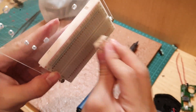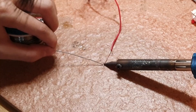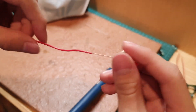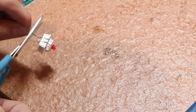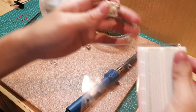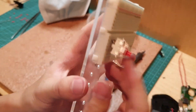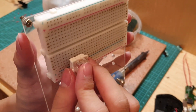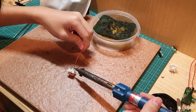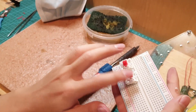The pins of our switches are not long enough — what do we do? Well, it's very simple, we just need to make the pins longer. I do this by attaching a long wire to those switches and cutting it off once it's soldered onto it. Now we can attach the switch to the breadboard. Do this for the other switch as well.